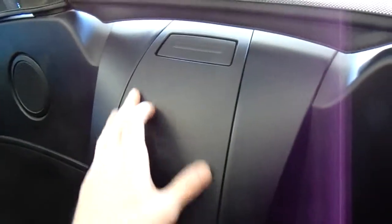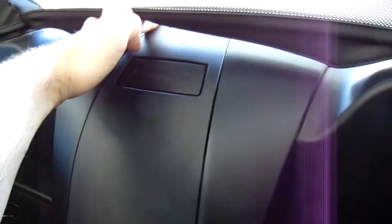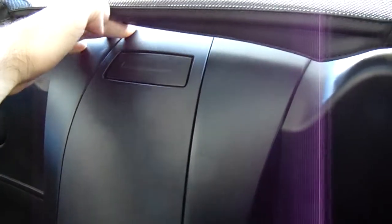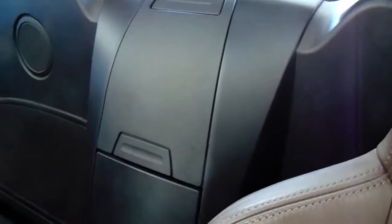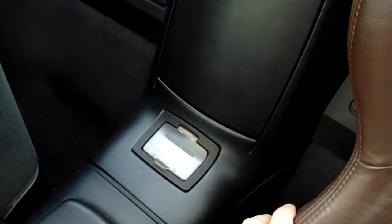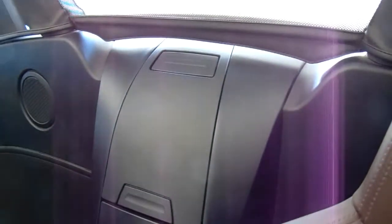This piece actually was kind of tricky. I had to shave one of these little outcroppings here to get it to slide in flush, but that was actually not too bad — it came in pretty good. The wires hooked back up just fine, no other issues. I would definitely raise my top up before going in there. I'd either remove this completely or loosen up the ends so you can slide it up and down, because you will need to do that for this install.